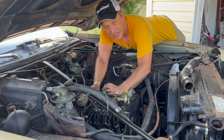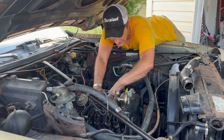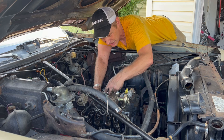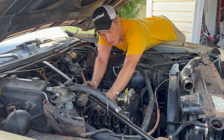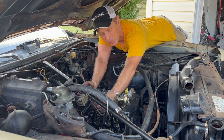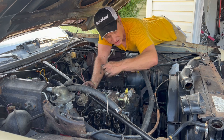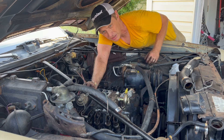I've watched a lot of YouTube videos, and what I've discovered on shows that do dyno tests is that there's not really an aftermarket intake manifold that beats the stock dual-plane cast iron intake for low-end torque. Are there some that are close? Yes. Do they save weight? Yes. But am I worried about weight in the front end? No. So I'm not going to waste money swapping the intake — I'd probably actually lose torque, which is what I'm trying to gain.